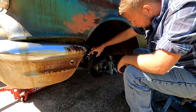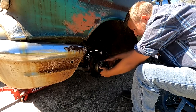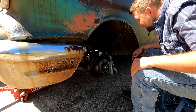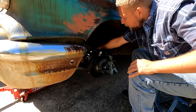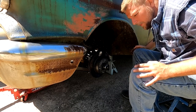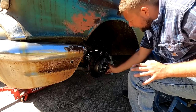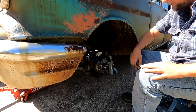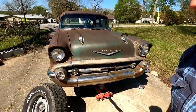We've got no reason this side over here should be sticking, because it pulls to the right like it's got more braking power over there. There could be air in the line — could have to bleed it out. The brake pads look fine, and so does the rotor.